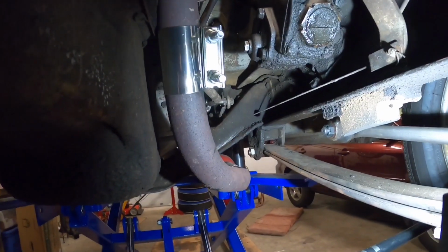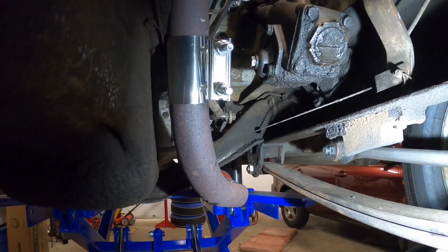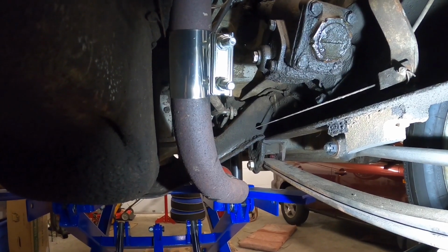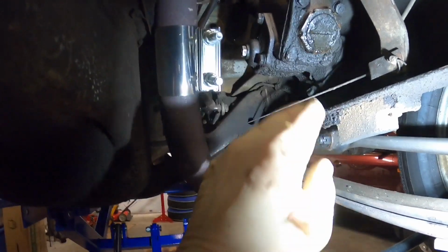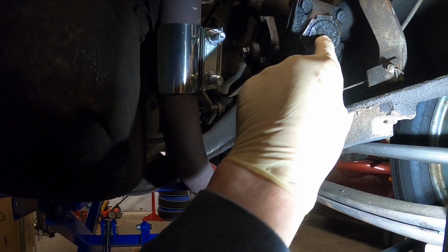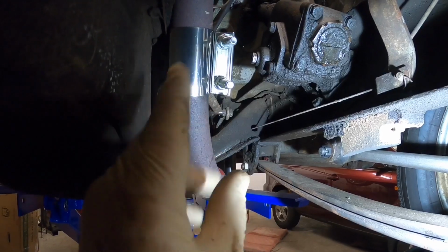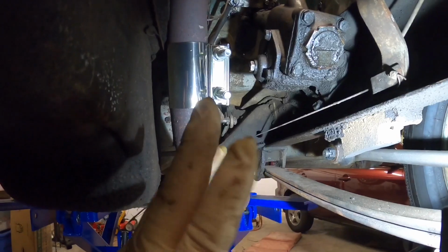Then we'll do a pull test on the steering wheel, and I'm just using an old fish scale that I have, and you're looking for about 1 pound to 1.5 pound pull weight on that. If you don't achieve that, you come out here, use your little punch and hammer, loosen your lock nut, and then this large adjusting screw, you take the slack out of the bearings and go back in and do another test till you get between 1 pound and 1.5 pounds of resistance.